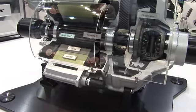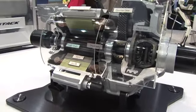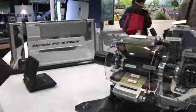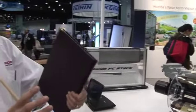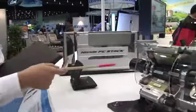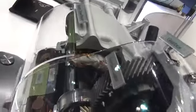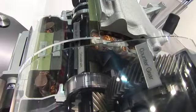This is an eight pole motor, and basically what that means is we have a PDU — power drive unit — that switches between these poles as the rotor turns to various poles in the stator. We turn on the current, which causes an electromagnetic field that pushes the motor around. We also make use of what's called reluctance torque with this motor.